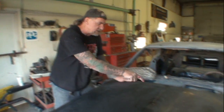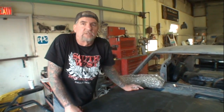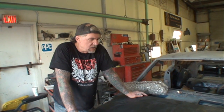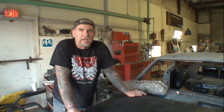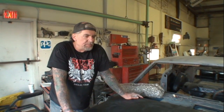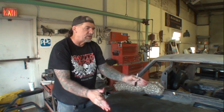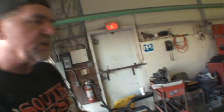The next thing we're going to do is start drilling our holes. Now, we're going to ask ourselves, what size drill bit should we use, my friend Pete? What you want to do is use a drill bit that's bigger than what you have. And the reason for that is why? Bigger than the nut or the stud, so it goes off and on easier. Also, using a bigger drill bit is going to let you move the grill back and forth, kind of shimmy it around to make sure that it's centered up properly the way you want it. So you have a little bit of adjustment.